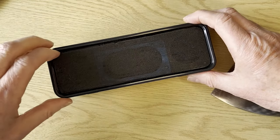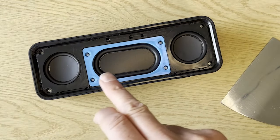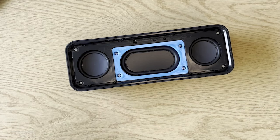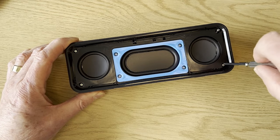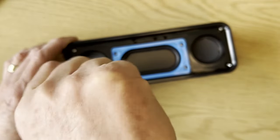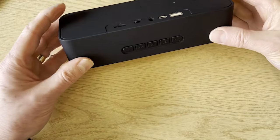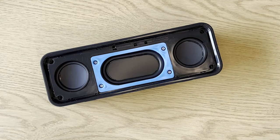There's a bit of protection there and underneath that you can see three things: two speakers and a passive radiator to help the bass response. The next stage is to get the speaker assembly off — there are four screws here, so we'll undo those and get them loose so we can take this out quite easily. We also need to remove the four screws around the passive radiator — that blue element on the front — as this is likely to hold in the front panel as well.